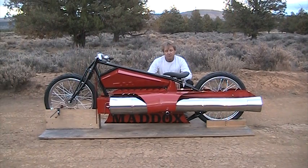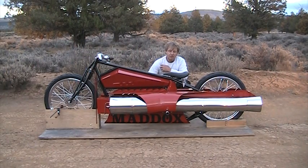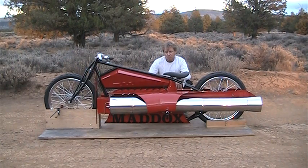It's about a 250 pound thrust bike. I just did a test run on it, you'll probably see it on the video. I had it jetted to where it was running really good, and then when I tore it down to powder coat, I jetted it up and put it back together to see if we could get a little more thrust out of it. I got the jetting a little too tall, so I'll pull the head back off and knock the jetting down a little bit. If you get it too tall, it'll go rich and just go out when it gets too much fuel — not like a car engine where it'll just start losing power and smoking. These engines will just go out. I'll knock that down a little bit and get it really dialed in to full tilt.